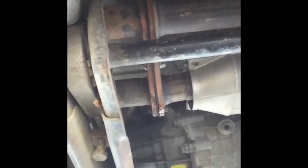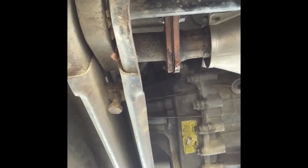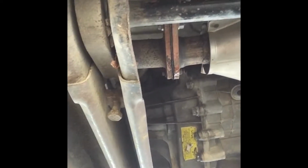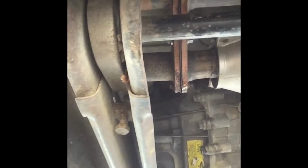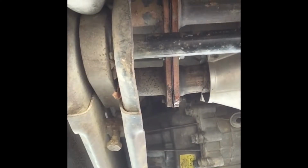Anyway, the seal right between the cat and the muffler is a little bit not flat, and so it doesn't seal well. You can see a drip of water there, I hope. I'm going to do something about that gasket today. I put that in and it leaks like a sieve. And of course, if it gets bad enough, it fails my O2 sensor.